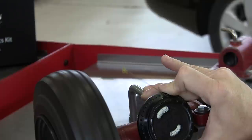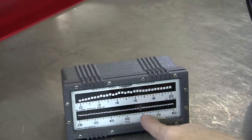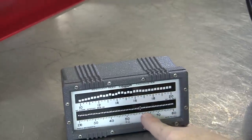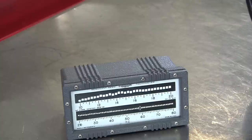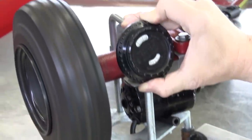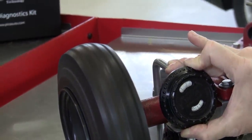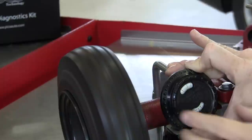It's telling me here that it's about 58 hertz. And if we look at the reed tachometer on the bench, you'll notice it also has a reed shaking at 58 hertz. So they're both corresponding with each other and will show us what frequency we're feeling as we drive a vibrating vehicle down the road. Now let me shut the power off.